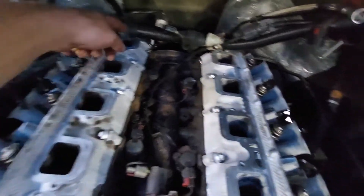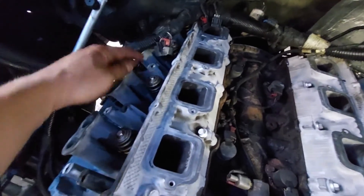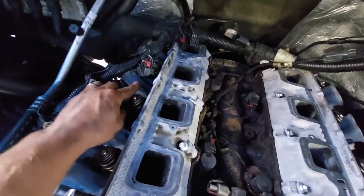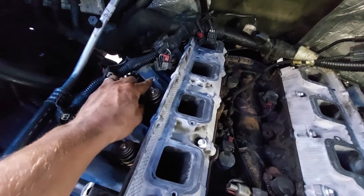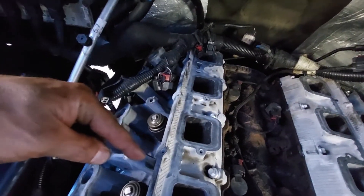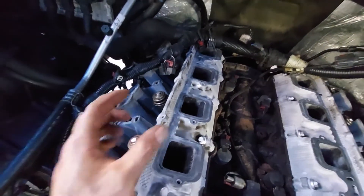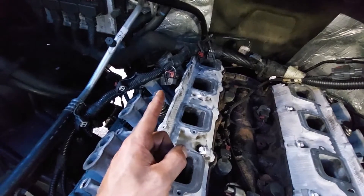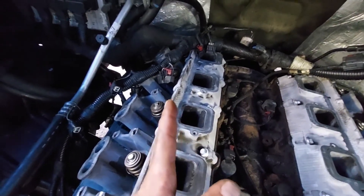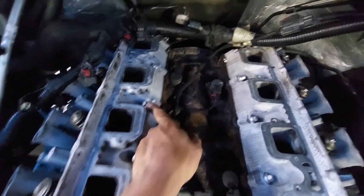Working your way from the inside out on the 10mm bolts at 15 foot-pounds. Then the main 1-through-10 bolts go to 40 foot-pounds. Re-torque the 10mm bolts again to 15 foot-pounds after that. Finally, the 1-through-10 bolts get an additional 90 degrees of rotation. That means wherever your wrench is pointing, rotate it 90 degrees from that point tight, going 1 through 10. They do make a special turning indicator — essentially a dial with a pointer so you know exactly what 90 degrees is. You don't need it if you're careful. The final torque on the 10mm bolts is 25 foot-pounds.